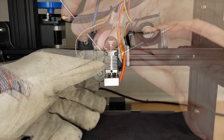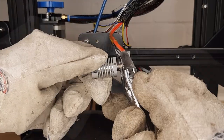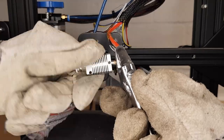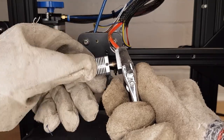This is why we have the gloves. Turn the printer off and remove the screws that hold the hotend to the x-axis carriage and then completely remove any screws that go from your heat block through to your heatsink. Hold the heat block in the jaws of your adjustable spanner and then unscrew the heatsink and heat break as shown. Count the number of turns it takes to unscrew it or measure the distance between your heatsink and heat block first to make reassembly easier.